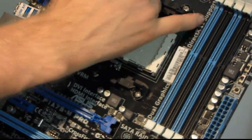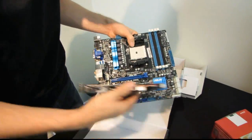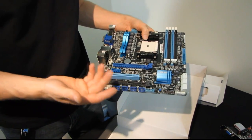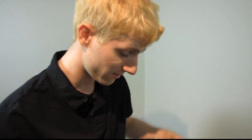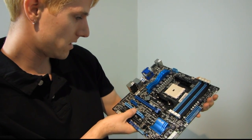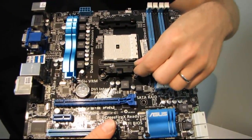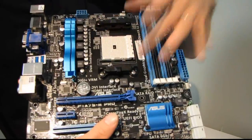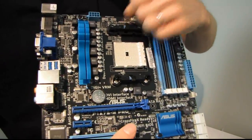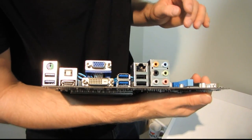You've got dual graphics with DirectX 11 support. Dual graphics means you take your APU's integrated graphics and combine it with a discrete GPU — they work together, kind of like hybrid Crossfire used to do, except it actually seems to work quite well this time. Also, the CPU bracket looks a bit different from previous AMD motherboards, but it's still compatible with older AMD-compatible heatsinks. Same mounting holes, same clips — so you won't need to waste money upgrading cooling solutions that still work fine.